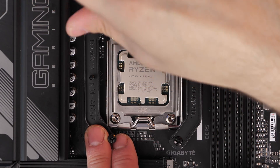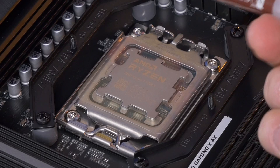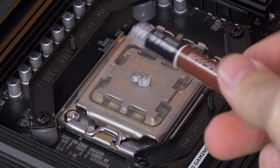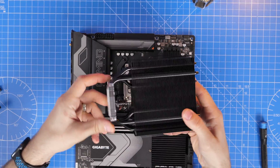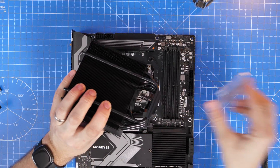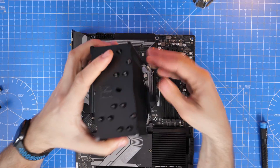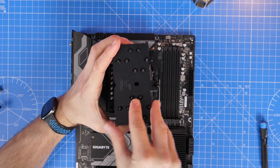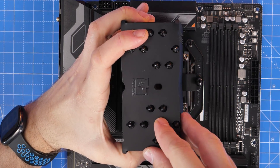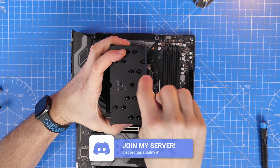Once that's secured, we need to put the thermal paste down. Thermal paste application is up for much debate and Noctua has tips on the best way in the manual. Then get the cooler itself — there's a plastic cover on there that you need to remove. Pay attention to which way around you install this because the bracketing is slightly different: it's longer on one side than the other, so you want the Noctua logo on the left hand side. Then secure it down on top of the two screws that come out of the brackets we put on the motherboard.